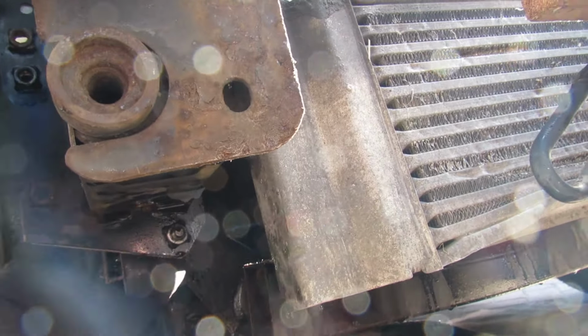Right, so we're going to replace the drive belt tensioner. It's this one here. Already told you what that size is. And these little bolts are E10. They are Torx, but they're E10. And the thing to do with this is to bring it round and then put a pin in here, and then you can get to that bolt. Otherwise, this pulley's in the way. So you'd need that 17. And you just put it on there. Now we've locked it in with a little Allen key, just to hold it out of the way. This locking pin, and we need to remove this one here. Otherwise, you just cannot get to it.